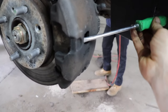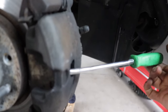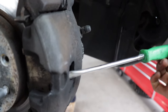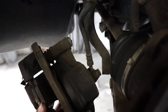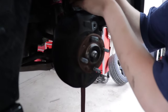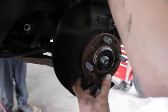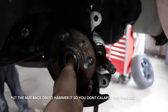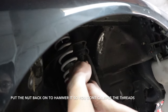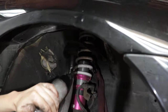What I did was take a little screwdriver, stick it in here, get into the caliper back here, and then just pry on it — it releases the piston. Don't forget your hose bracket, and then we can just hang that up somewhere. One and a quarter took off the axle nut — don't know what the metric size is for that; it's not important. Sometimes you've got to hammer the axle, but this one's loose so it just comes off like that. Last but not least is the upper ball joint — knuckle will come off and then we can press this thing apart.